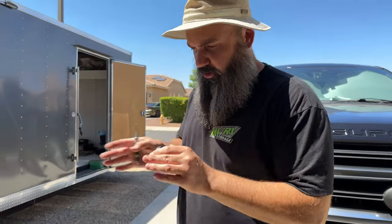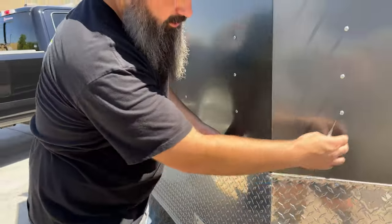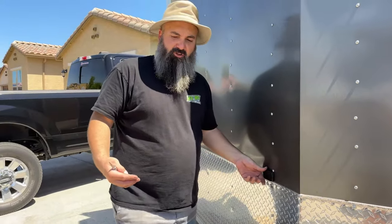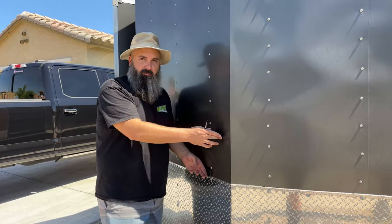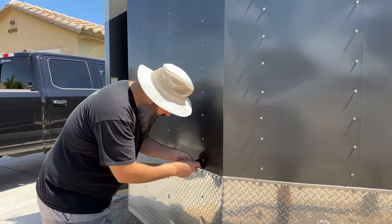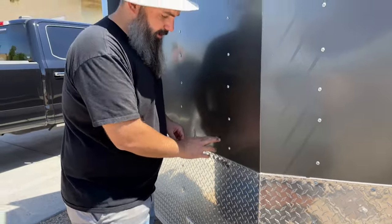Up front, I just want to spread light around the axle - that's what I'm going to use these rock lights for. My plan is to mount them on either side of the V here. I'll use the stud here and the stud here just to get some spread of light in both directions. When I'm loading with my truck, it's got a light right in the middle - this is just going to be for a little bit of added security. Inside the V, there's a flat portion that runs across here in the middle, and I want to make sure I'm on this side of it to get the wires to pop through. I'm going to pre-drill that hole and then use a self-tapper to go into the stud that's back there behind.